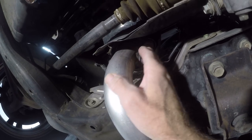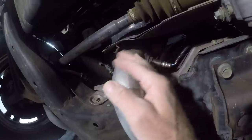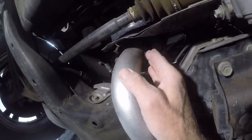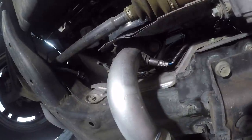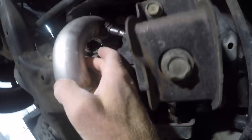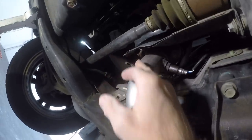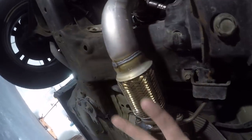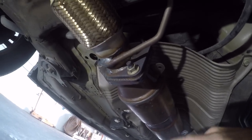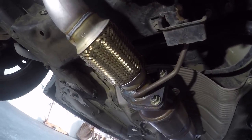And part of it is going to be to cover these bolts so you can't get to them easily. So the exhaust clamp that goes around here is going to have a plate with a couple of tubes on it that goes up so you can't get to these bolts and get those out very easily. And then we're going to run the cable from that one along this inside here, all along the top, and use the exhaust clamps to clamp around it in certain spots, and then weld those nuts so it doesn't come off. We'll also run at least one on the underside here too, possibly 2. It depends how much cable we have. I think we'll have enough. And then that should protect it, so they don't have to spend another $2,000 on this thing. So let's get to work.